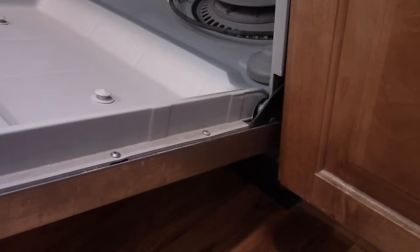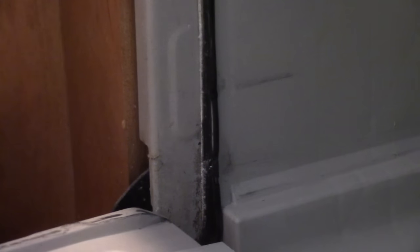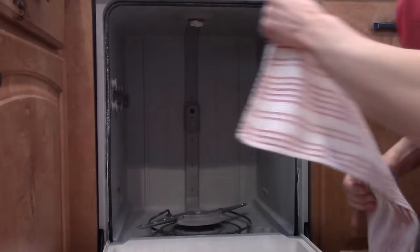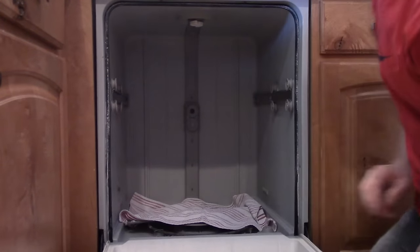While you're here, you might want to look at the screws around your door. When these things come loose, and they often do, it can stop your door from closing all the way. Also, if you have a hole in the gasket around your dishwasher, it can leak — so if your dishwasher's leaking on the floor by the door, that might be the problem. Before you take out any screws, lay a cloth down so that they don't drop inside. It can be really annoying and it happens all the time.